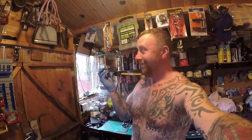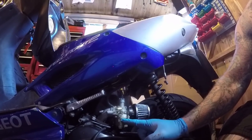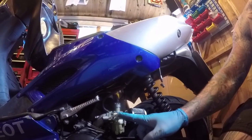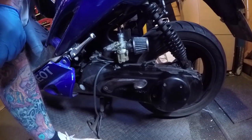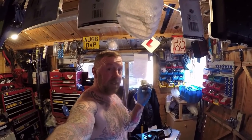I talk about these a lot. That looks old, works perfectly. Cheap Chinese carburettors — I hate them. And I notice something missing, like the oil pipe. Here's a bit — it's pre-mix, they've removed the oil pump. Got one missing cover here and here. Back to the crappy carburetor again — oh, how much do I hate these.